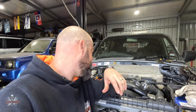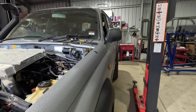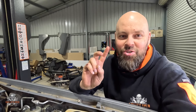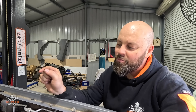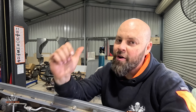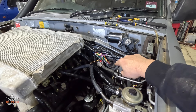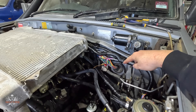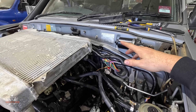I'll give you an update on where we're at wiring-wise. I made two errors on this one that I didn't make on the EH. The first one was I looked at the wiring diagram and it says the start trigger wire is a black-red or a black-white. I chose the black-red because it was the biggest one, but it was actually the black-white.